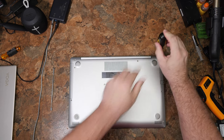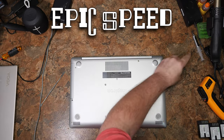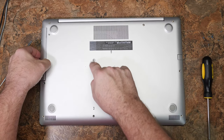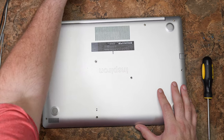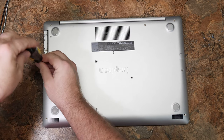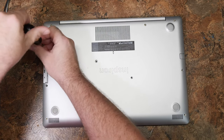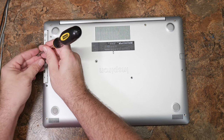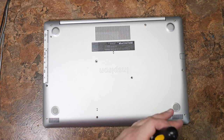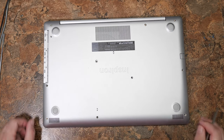Take out all the screws. Some of the screws did not come out. The DVD drive, which is held in here, should slide right out — and as you can see, there are two concealed screws underneath it. Also be aware there are two different sizes of screw that go into this unit. Some are way shorter than the others, so make sure you put them back where they belong. There appear to be only two short ones; one goes to the DVD drive for sure, and I believe the other goes here — we'll find out.